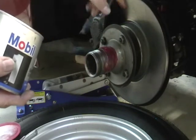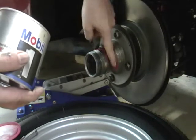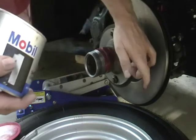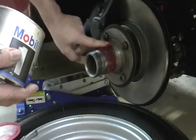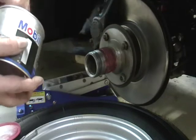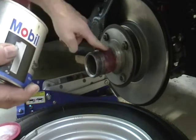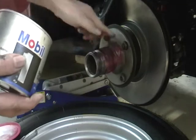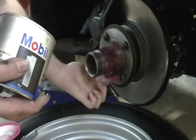While you're doing this, you don't want grease on your rotor. Go ahead and grease this up — put more grease on it than it needs, again not touching the rotor. I put just a little smear on the threads around the outside edge — you don't want to load that up — and I run my finger on that thread once. It's all going to get wiped off again, but I want the thinnest film possible, so I just wipe it around and wipe it off.